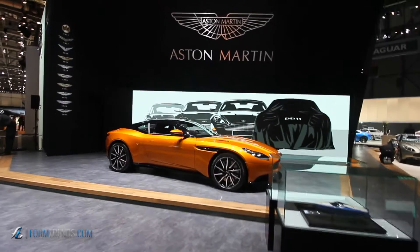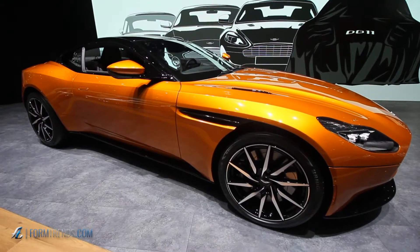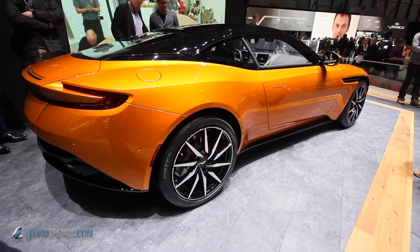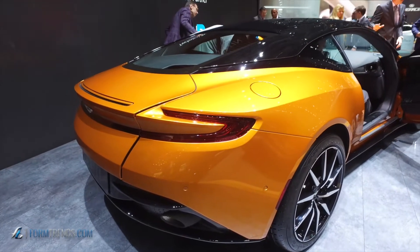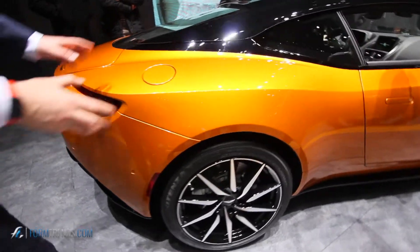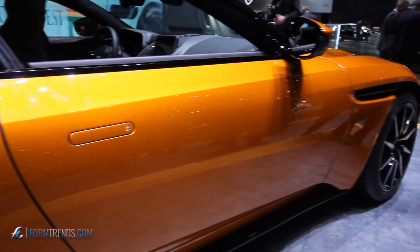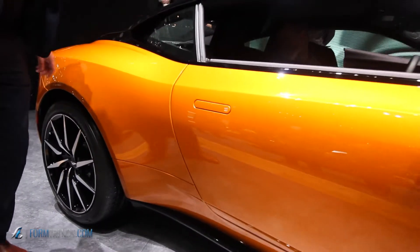In terms of the overall proportion of the car, with the DB9 we have a wonderful starting point, but we've tried to amplify wherever possible. The front wheel versus the DB9 is now 65 millimetres further forward, meaning we can get the A-pillar shooting straight through the centre of the front wheel. The front overhang is slightly shorter, the rear overhang is about the same, and the overall dimensions are very similar. We have much crisper, more consequential lines on the car — this line refers to the aero beneath it, and the width of the tyre beneath that. They are stronger, more assertive lines, but very consequential in nature. We have more sculpting down the body side, more cigar shape through here, and more bottle through the length of the car.